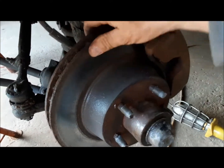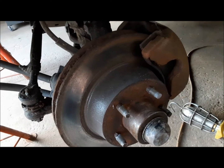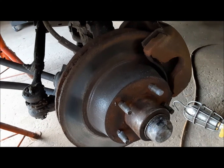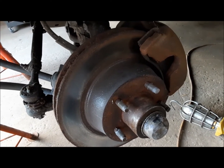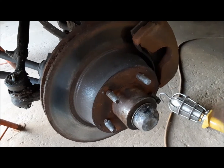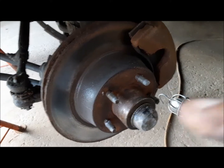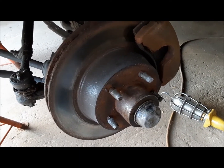I had a look in here — the brake rotors are fine, the calipers and all that stuff is good. I did find it needed an idler arm; the bushing in it is starting to get a little loose, so we'll change that. And it's got a heck of a transmission leak — it's such a mess I can't even tell where it's coming from, but it doesn't look like it's the converter seal, which is the good news. So I'll service it up: I'll get a transmission filter kit, change the selector seal, change the kickdown seal, and change the neutral safety switch because when I took the plug off it, there was transmission fluid inside it — they will over time start leaking right through them. Hopefully that'll take care of the transmission leak.